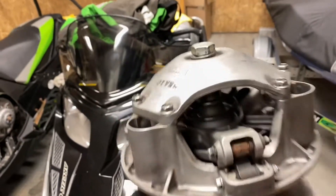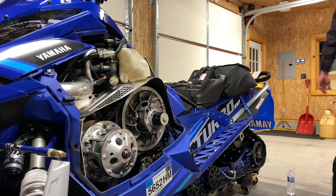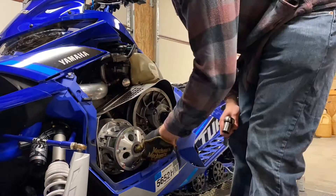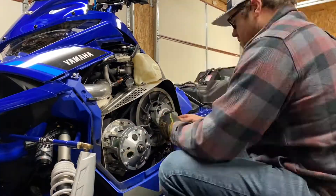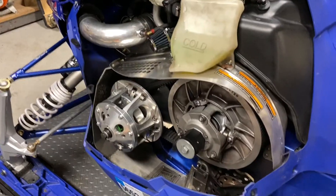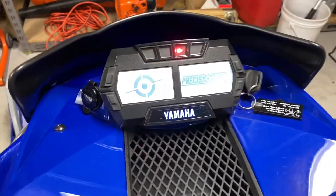Always keep your tools together — put the bolt right back in the clutch. Got the new clutch on, did a little adjustment beforehand. First time I put it on I was engaging around 4,000 RPM. Messed with the set screws a little bit and we're getting 3,200, which is pretty mint for the spring I'm running.